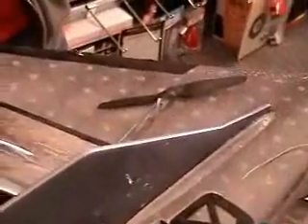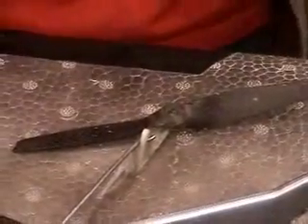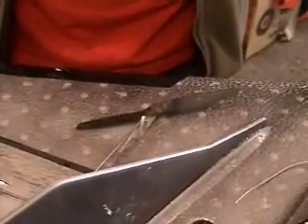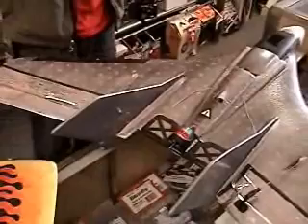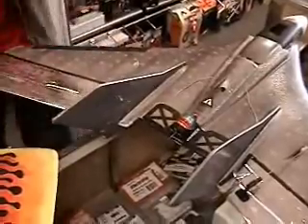I'm going to try out my carbon fiber prop on the old Striker. One side's cavitating more than the other. I think the reason is I didn't mix the epoxy right — I tried to do half pump and a half pump, and after eight hours it was somewhat tacky still. I didn't heat up the mold before I put it on there.